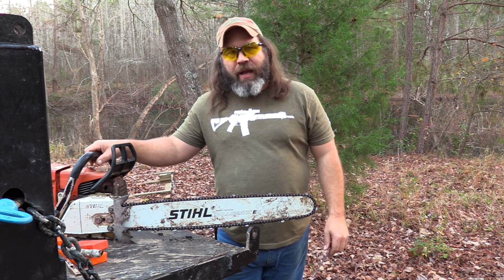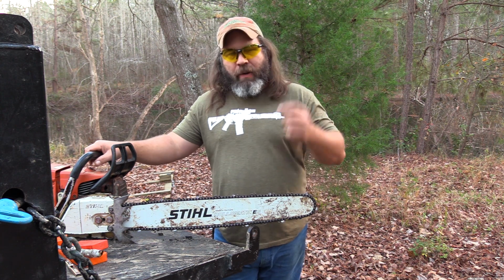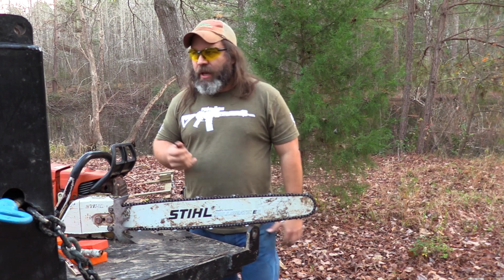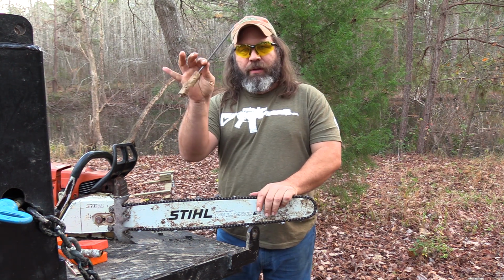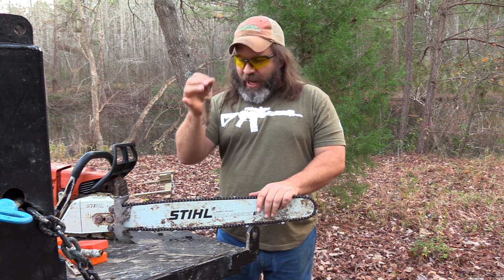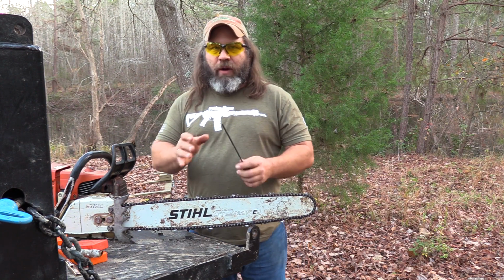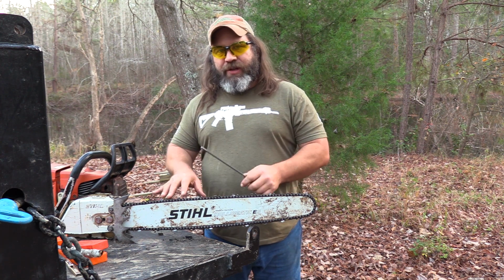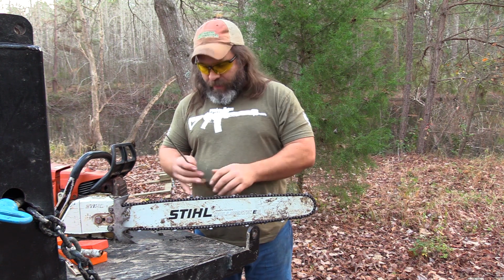And I know they make all kinds of little stones you can put on your Dremel tool, and you can sharpen it right up, lickety split. That's great, but if you're out in the middle of nowhere, in the woods, you ain't got nowhere to plug that damn Dremel tool in. So that's where your 7/32 file comes in. This is a 7/32 file for my 3/8 chain on this 066. However, there are several different size chains, and whatever chain you're running on your saw is going to dictate what kind of file you need to sharpen the teeth.